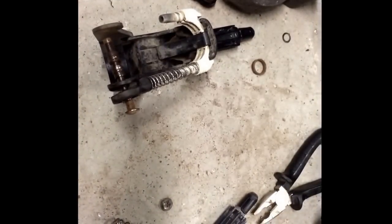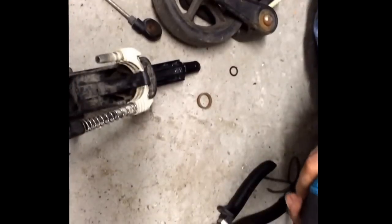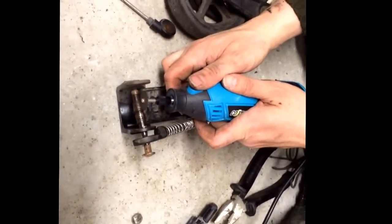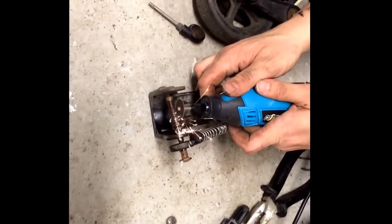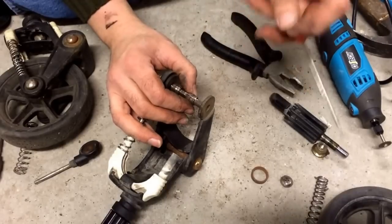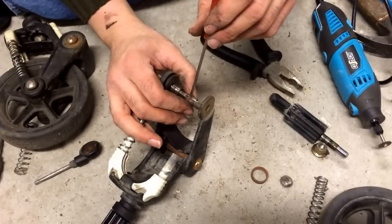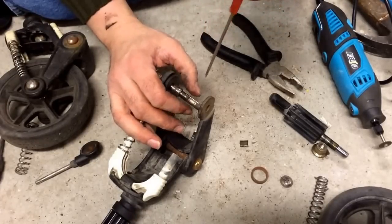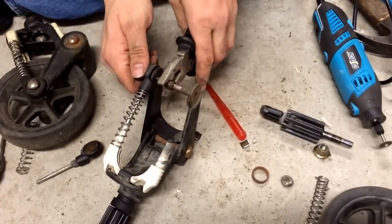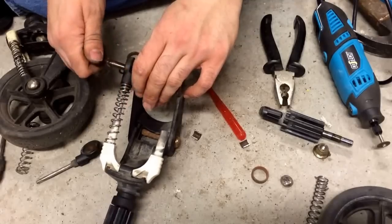Now I'll show you how to use a Dremel to remove the rusted inner ring. Put on some safety goggles. You want to use some sort of a cutting wheel attachment and turn your speed all the way up. So you have sliced a groove through the piece — you can use a thin screwdriver to wedge it in and try to pry it. I did this off camera and because it was so hot it just snapped and fell off. There's a little bit of scarring on the axle, but it's so small it won't have any structural effects. Now I can get the axle out and begin to replace the wheel.